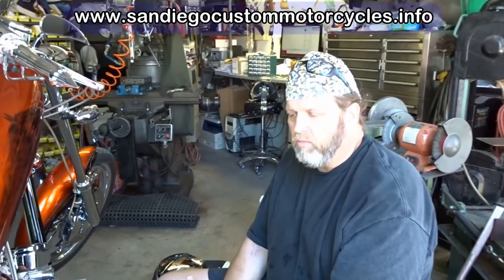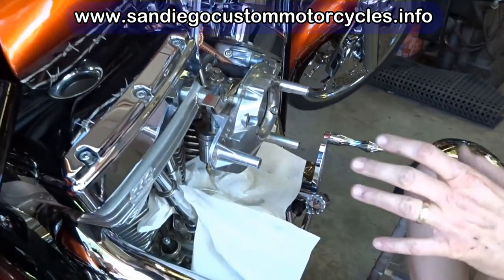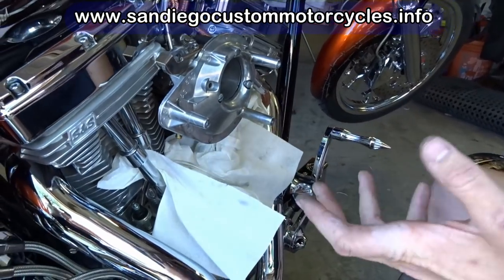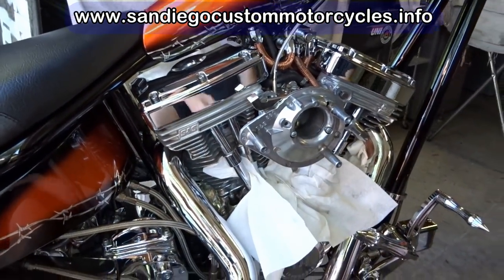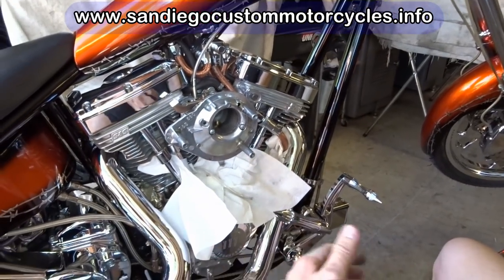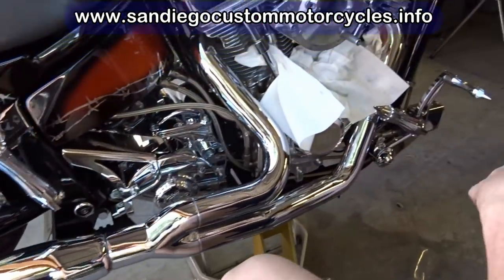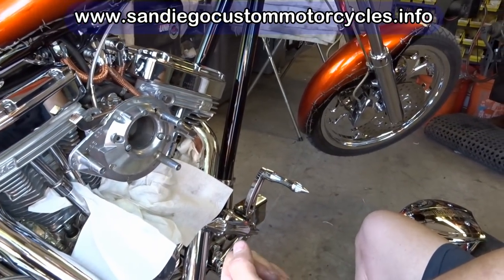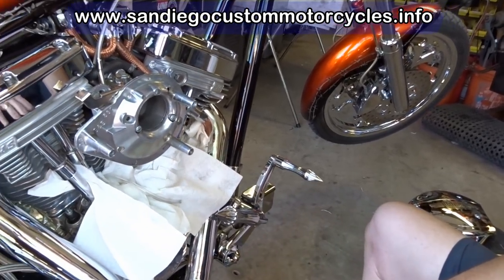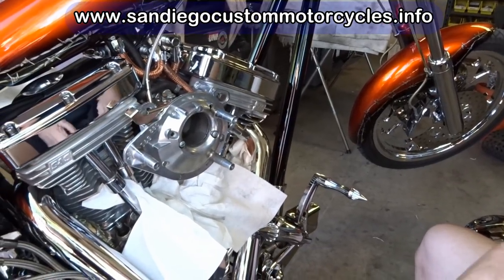Having not known this bike before and what anybody's done to it, on some initial tuning setup issues, I found that I was having to turn the air idle screw in all the way which wasn't doing anything, and the accelerator pump wasn't affecting anything when adjusted. So the assumption is that we've got a main jet and possibly an intermediate jet that have been upsized because of some previous aftermarket pipes. These are stock pipes the customer has now put back on the bike. So we're going to open up the bowl and see what jets are in this carburetor now. On a G-Carb on a 111, it probably should have been like a 29.5 and a 74 — something in that range. We'll take them out, find out what they are, and make our assumptions from there, likely decreasing the size of the jets.